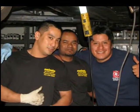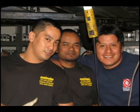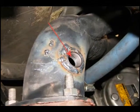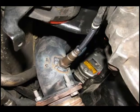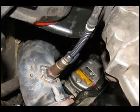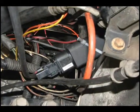Here's a shot of the friendly Meineke Car Care Center guys that welded in that bung — thanks guys. With that bung welded in place, we're ready to install that Bosch wideband oxygen sensor. Just screw it on in and you're on your way to data logging accurate air fuel ratios. Then we just connected the oxygen sensor with the lambda cable.